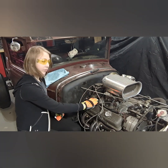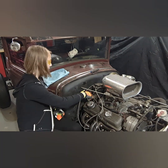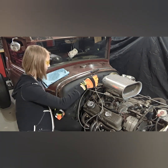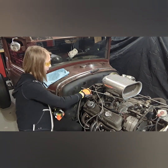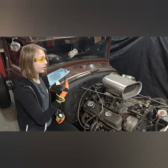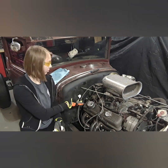So the dipstick — there's two dipsticks, one over there and one over here. The dipstick for the transmission is this one over here, and it's nice and red. I can't actually check it unless it's running, and it's either in park or neutral, depending on what kind of car — that's how you really check it.